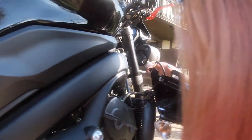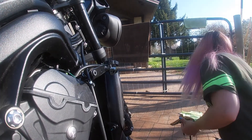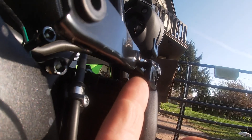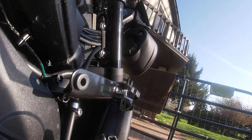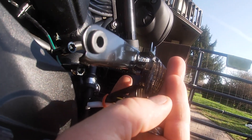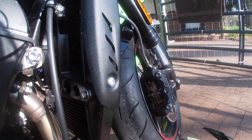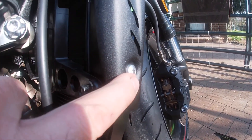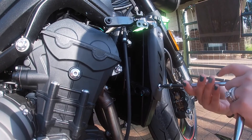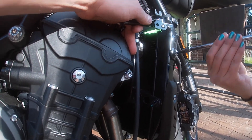That would be dielectric grease — it helps keep the water out. Now we've got them loose, so go ahead and pull that out. Set your plastic down without scratching it. There's a hex nut on the back here which is what the old one screws into. The new indicator light has a pre-built stud on it and it goes through that spot. The problem is on the other side there's not enough room to get that nut on due to the radiator tubing. So we're going to take out this torx bit and this one — that's going to take the bracket completely off the bike where you can mount the light and bracket together on the inside of the plastics.